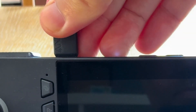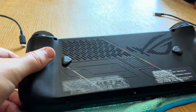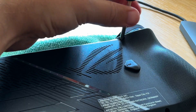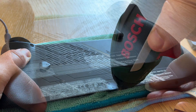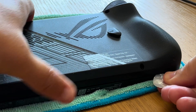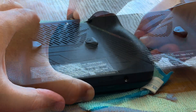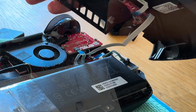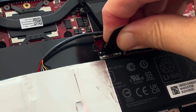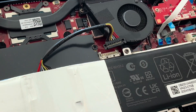Remember to unplug and remove an SD card if we have one inside. I'm going to rest my Ally X on the two cardboard stands that came with it, and also a cloth. Next, let's remove all six screws from around the Ally X, with the middle bottom one not actually coming out. Then we get something like a guitar pick to carefully go around all of the sides to gently separate the top and bottom of the case, which can be a little bit finicky, so just take our time. As we pull them apart, there is a little ribbon, so let's be gentle. To be super safe, let's move the battery by using our pick to slide downwards the silver bracket, and then gently use our screwdriver underneath the battery to pop it out.